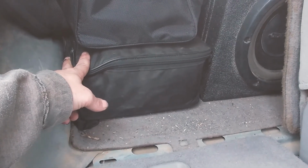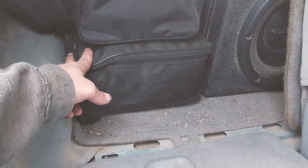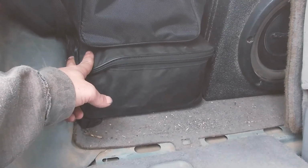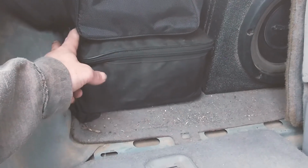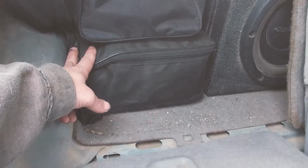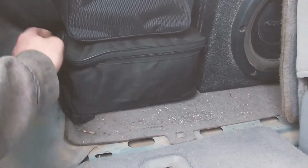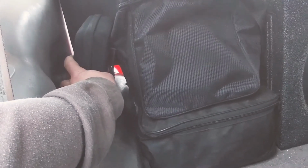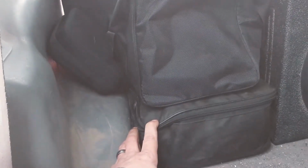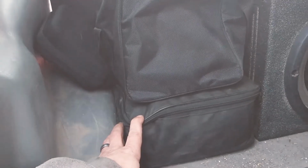And when our truck's 6,000 pounds and you're stuck in the rocks or the mud and pulling uphill, I'm just not comfortable with 8,000 pounds. So I went ahead and upgraded the D-rings to 8-ton as well. We got our 2-ways. Got to have those with the spotter, vehicle, extra vehicles, whatever. Got to have a 2-way. So that's it behind the seats.